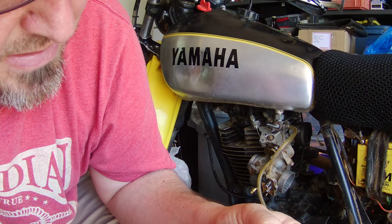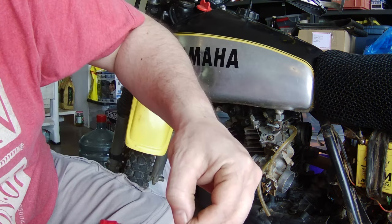We have a 27.5 pilot jet - they're stamped on here but really hard to see. The stock jetting is, I want to say, 20 or 25 - and if it's 25, then 27.5 really isn't that much up, so I'm surprised it's making that big of a difference in the running condition. Jetting is kind of trial and error - every bike is different, especially after 40-plus years of wear. This carb has been rebuilt with new parts, but rebuild kits don't always work as great as original parts. I try to always get actual Mikuni or Keihin parts, but sometimes it's hard to find for some of this stuff.